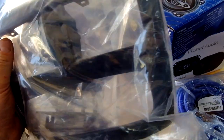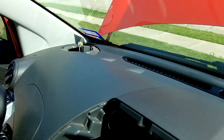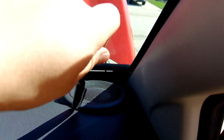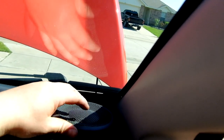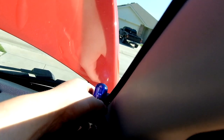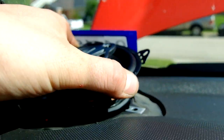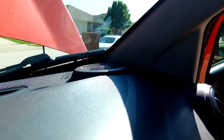The basic kit was like $25 versus $70 for the other one, and I'm just going to solder all the stuff myself. I already took off the left front speaker and I'm going to do this one and show you guys how easy it is. You literally just need a butter knife — at least that's the way I did it. They're not hard at all, it literally just snaps and comes right off. You need a little stubby screwdriver to get them off, and that's pretty much it for the front speakers. I've got them soldered up and I'm just going to stick them in.